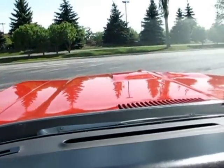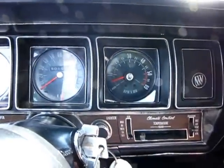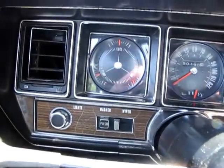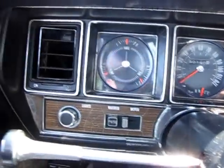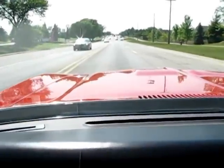We're going to get it on the road here for a second, see what it'll do. Factory original redline tach at 5 grand is working. Original temp gauge and oil pressure gauges are operating. Oil pressure is holding up at about 500 RPM, showing about 25% on the gauge. Cold pressure was about 3/4 on the gauge.